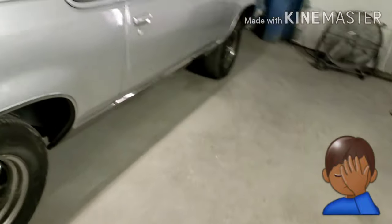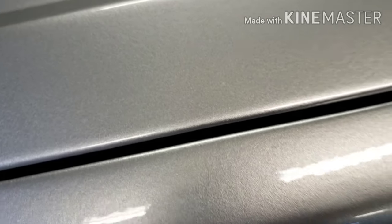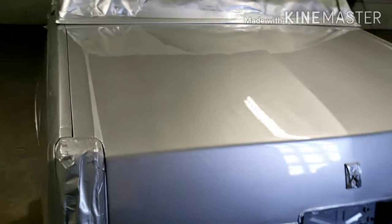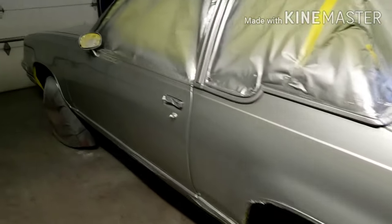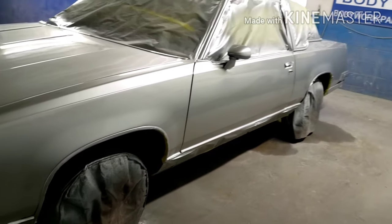Finna sand half of it down at night and the other half in the morning. Mask it back up, fix my little bodywork, seal it, paint it. Y'all stay tuned — the reshoot. Like the texture of it, way better texture from the other shot. I'm satisfied with this. The owner will be getting it — saying he'll buff it afterwards. So all the orange peel y'all see will disappear. It's shiny. I gotta say, I like the texture on this. Now that I'm done with this one, I can go on to the next one.